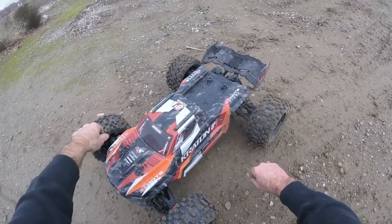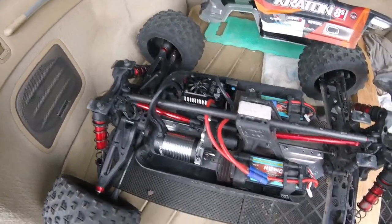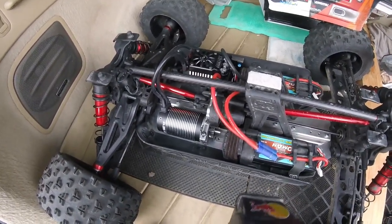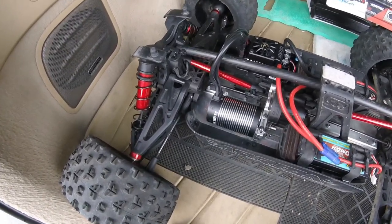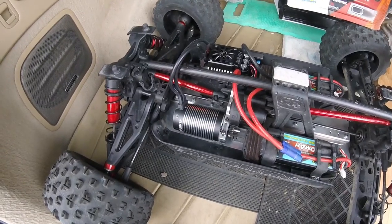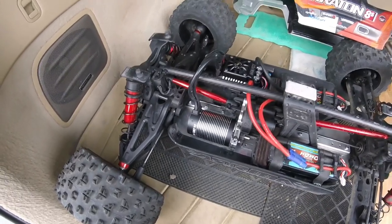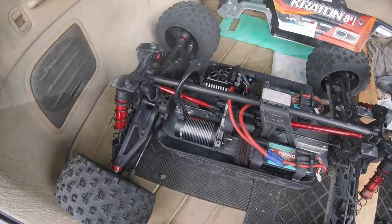Sorry for such a short video guys, but I'm not going to keep driving three-wheel drive and break something else. I've got my Max 5 installed — the soldering was really a pain, I'm just not used to soldering the EC5 with these bigger wires. I've got my 5687 in here still and I'm waiting for a bigger pinion right now. I've got a 25T, and I ordered a 27 and a 29 because the temps were absolutely fine on the motor with the stock ESC. Stock tires are back on and I'm just going to give this a quick rinse.